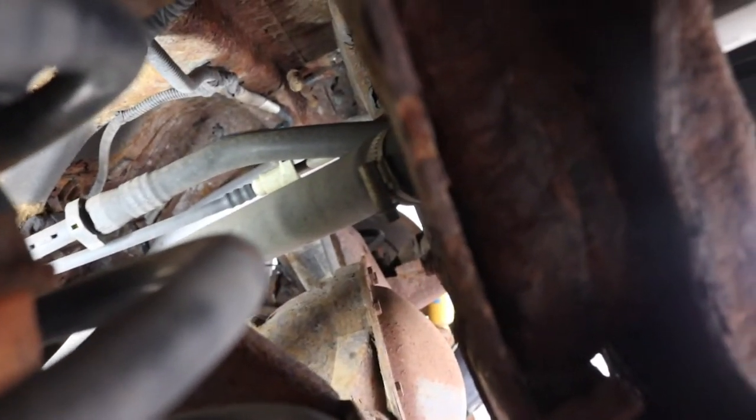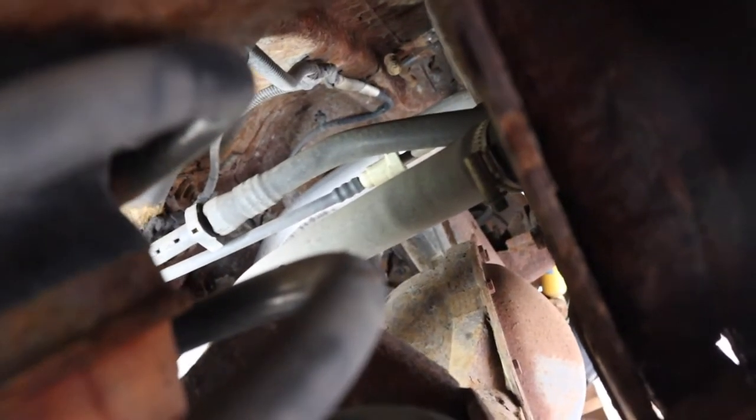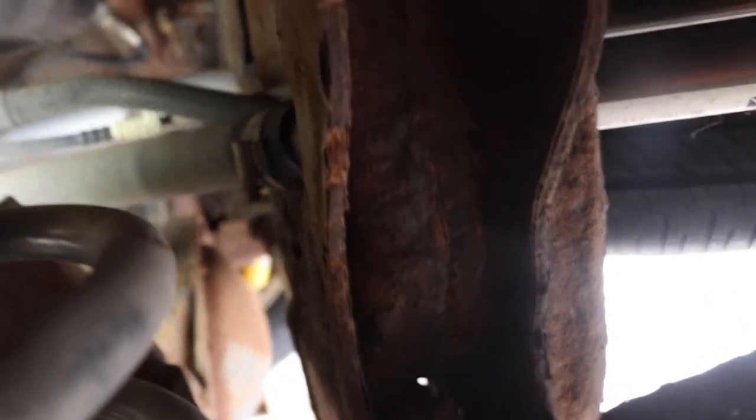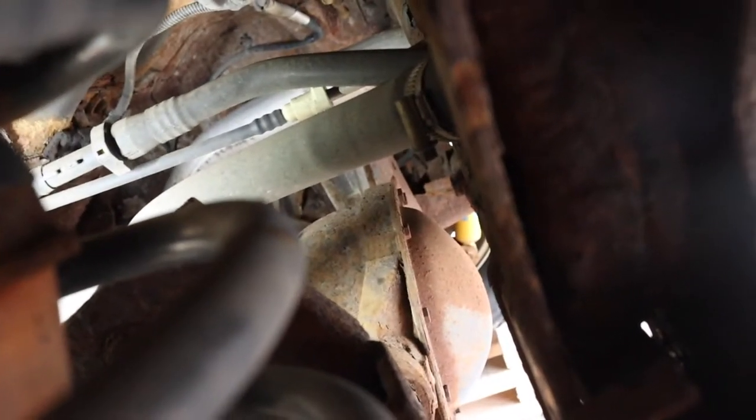And then, if we go back up in here, if you look at that white connector, actually I think there's two. So you've got that connector right up there, and then you've got the white connector. Those have to be removed. Both of them have to be removed as well. We're gonna undo that fuel neck filler right there, that white line right there, and then that line right there, and that is the backside of the tank.